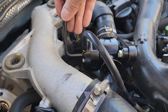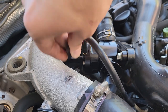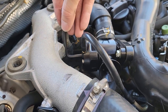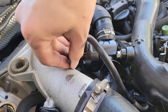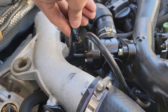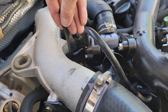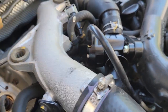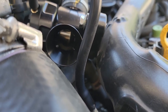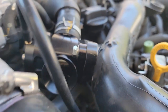Right. A lot of things I've seen on these ones, it needs to be pretty close to all the way tightened. That's how it is on the Maxima, too. All the way tight. Right. But the Maxima is weird. It sits here and idles at like 25 pounds of vacuum instead of 20 like every other car. Yep. Hang on. Alright, give her another little go. No, needs to go tighter.